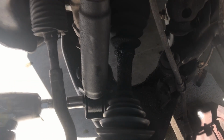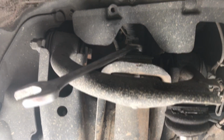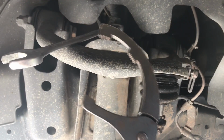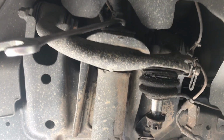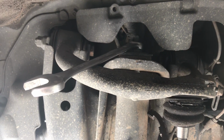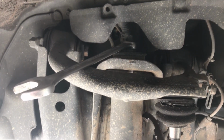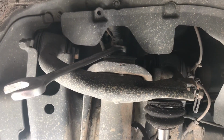Use 19mm socket and rattle gun to remove shock absorber. Be cautious of spring back. Potentially use jack. Using a 22mm implement and an oil filter pipe wrench thing, hold shock absorber while twisting 20-year-old factory nut loose on shock absorber. Prepare to curse and lose knuckles is best step.